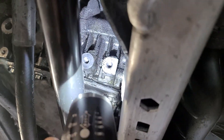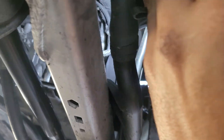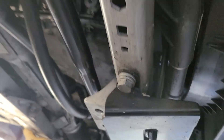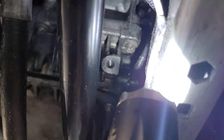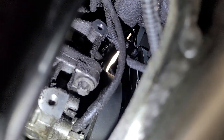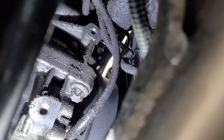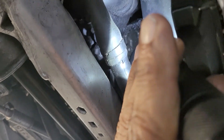Let's take a quick look here. You can get to that bolt — I'm gonna grab a quick flashlight so you guys can see what I'm talking about. There's the bottom two bolts on the water pump. The top one is right up in there, can't really see it. Trust me, you can get the socket in through here between this front frame crossmember — I went right through there and got to the top of it. You can get to that bolt up there through this side right here, with a swivel on it.